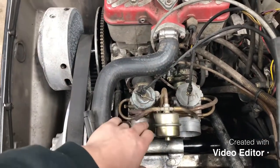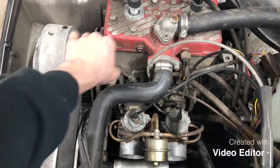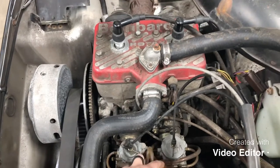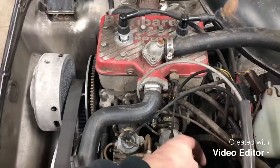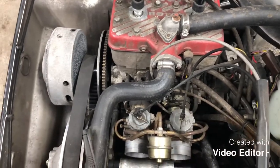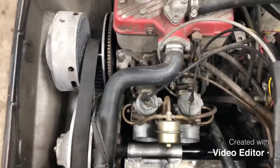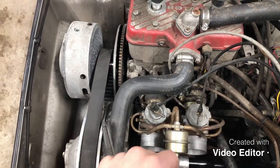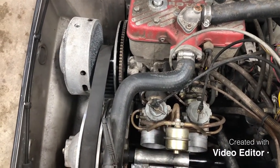But what that means is the PTO side of the engine is the clutch side, or the power takeoff is what that stands for. And mag stands for magneto, which is gonna be your other side or your recoil side. In other words, where the stator is at on this side of the machine. So it's very important not to mix these two up, as well as when we get farther along, it's very important not to mix up any of their internal components.